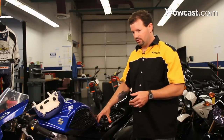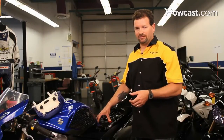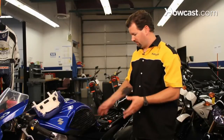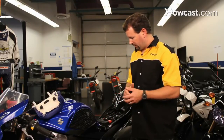One other thing you can do is a battery tender, which is available at most auto stores — it's a really good device. It will actually monitor your battery and top it off from time to time. Most modern batteries are sealed, so you should not remove the plugs to add any water. Once you seal them up initially or if they come sealed from the factory, that's the way they should stay for the life of the battery. Other than that, the best thing for your battery is to ride it often.